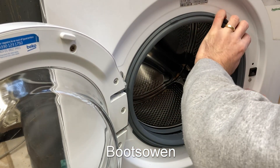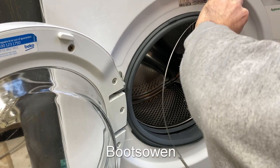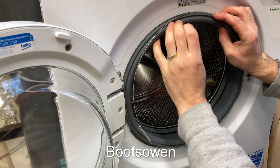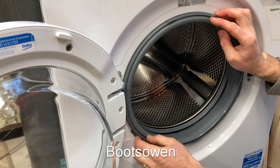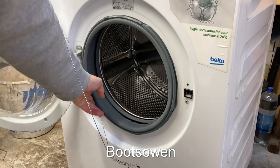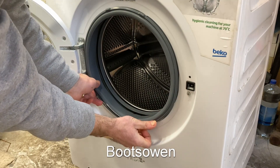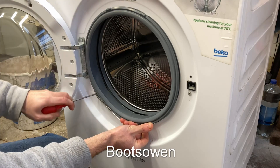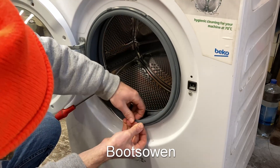It's just not perfect up here and over at the door lock. So take that spring and put it there, but begin up here because this is where it needs the help to sit properly. I'll start it up there and bring it around the top, down the side, pull it around so that it's protected here where the spring is meant to sit. I might find it easier if I have my knee up against it, or a third hand if you had an accomplice. I need to keep this spring here in position — screwdriver there against my knee, holding that in.